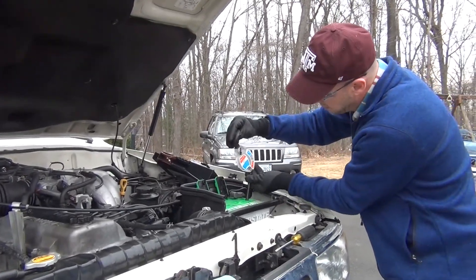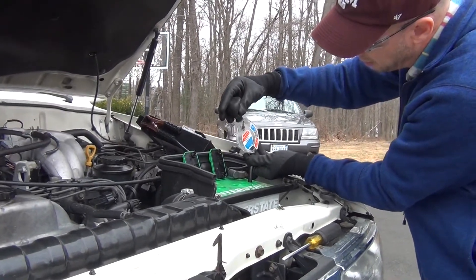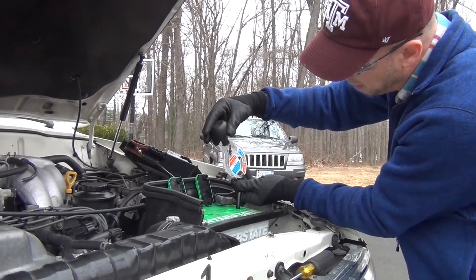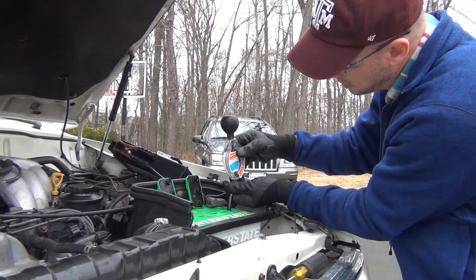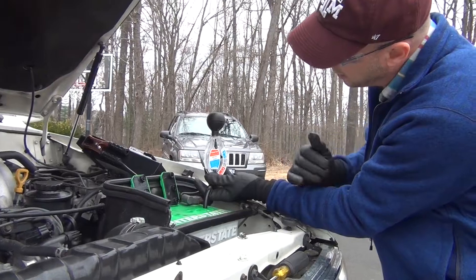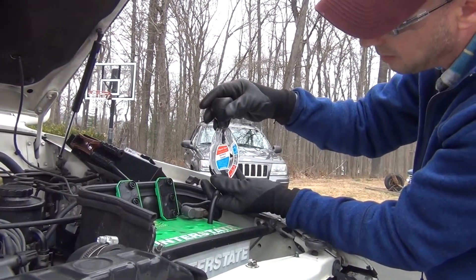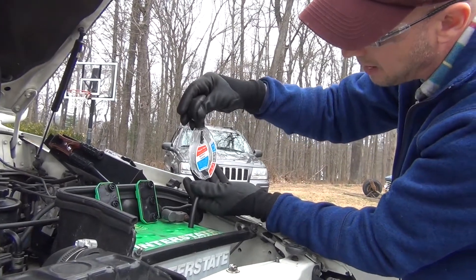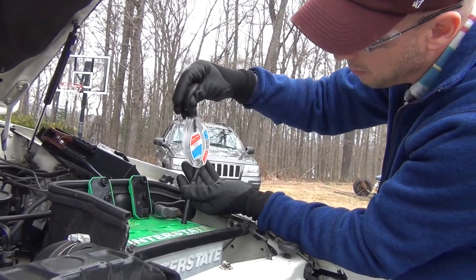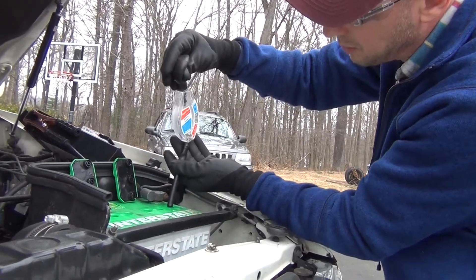I'll show you my technique. Go down in here — push the bulb all the way flat first, then go down in and get some of the liquid. Let it fill up slowly. Okay, now tilt this over to where the top is straight and you're going to look at your reading. That one's in the good range — it's at 1.275 — so for that cell we're good. Push the liquid back out slowly, and bring it to the top to clean it because you don't want to transfer liquid between cells.